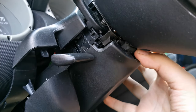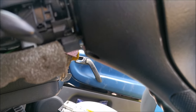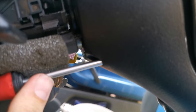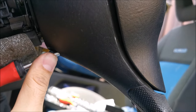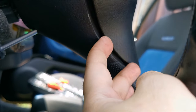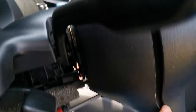It's quite hard to do with one hand, but it is out. Now we should have way more room in there. I'm locked behind it — look at the airbag, you could see it move. So now the bottom of it is unlocked. Don't let it lock — put something underneath it here, because we need to do the same on the other side, but we need to rotate the steering wheel so the other side is at the bottom now.